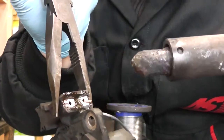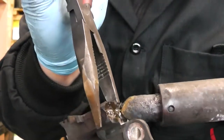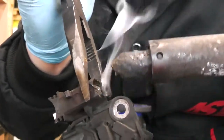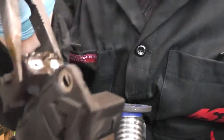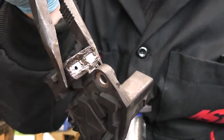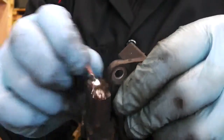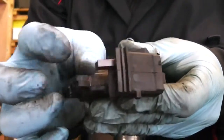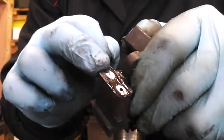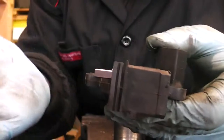We have our bit of solder here. Feed a bit of solder there and heat it up. The important thing to remember while you're doing it is that you want that hole to be blanked off by the solder. We have succeeded. Now just simply break off the wire, and our brush is nice and flexible in there. Never use too much solder because what can happen is the solder can run down the copper wire, harden the wire, and it will simply break off. Do the same thing with the second brush and then it's time to put everything back into the alternator.